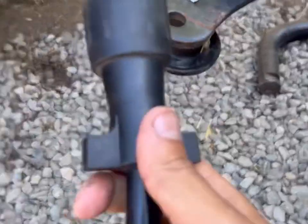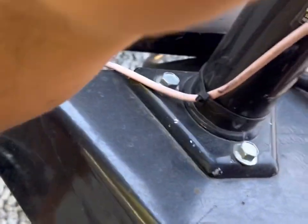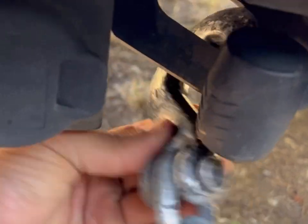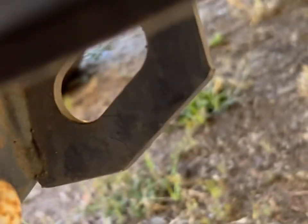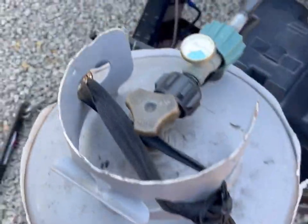The next thing I'm going to do is plug in the seven-way pin connection to my truck — just push it in, it has its specific groove. Now I'm going to get the safety chains and connect those to my truck as well. Sometimes you have to go at a little angle to get the chains in, but most of them are standard and go in the same way.